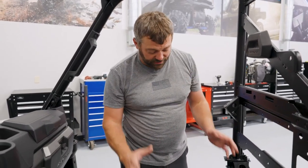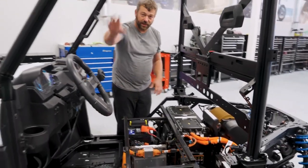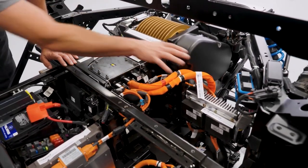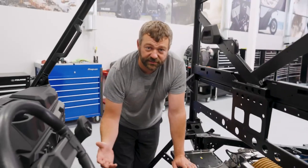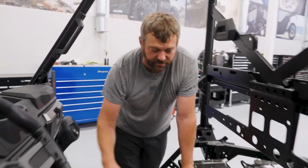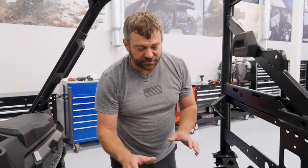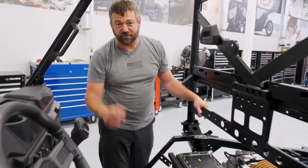There's a lot going on with all the different controllers and bits underneath the seat here, but just remember: power starts from the wall, flows down the cable, comes to the charger, from there it goes to the 100 volt pack. The 100 volts either goes to the motor controller and motor, or through the DC to DC converters for the 12 volt circuit. Things like headlights, taillights, gauges, and power steering are powered off the 12 volt, while other things run on the 100 volt bus. This Ranger XP Kinetic is full of great tech, highly durable, with all connections nicely sealed up and ready for the off-road environment.